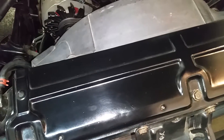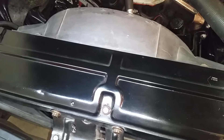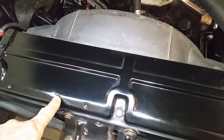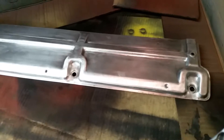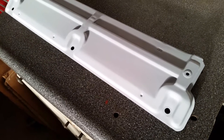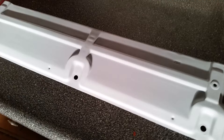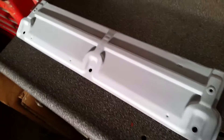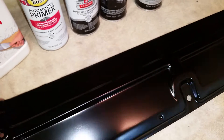So I think I'm going to repaint this panel — I've kind of been wishy-washy about it. I don't like this dent. I sanded down the top cover a little bit and used a paint stripper. Here's the cover with a coat of primer on it. The little dent that was over here is gone. It came out really nice — I'm happy with it for a rattle can.